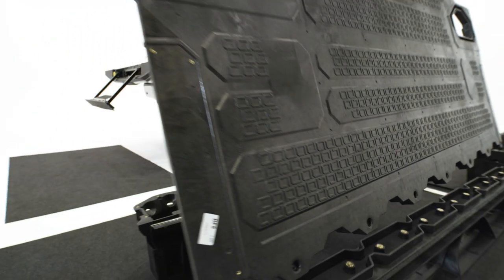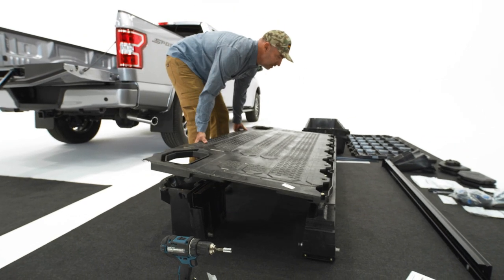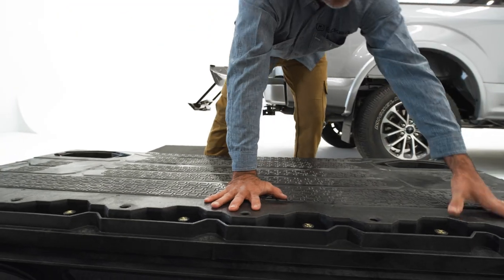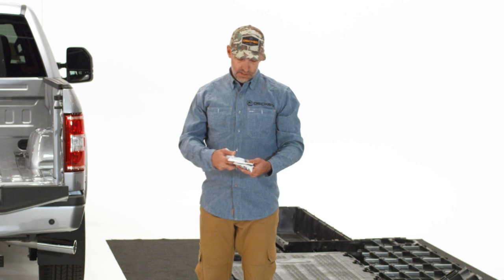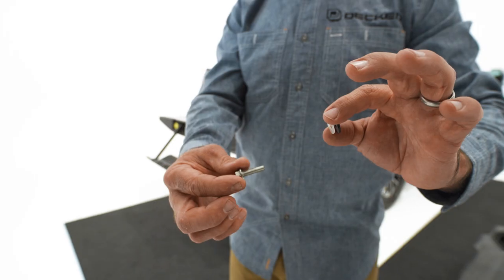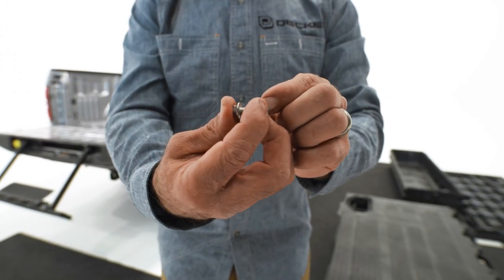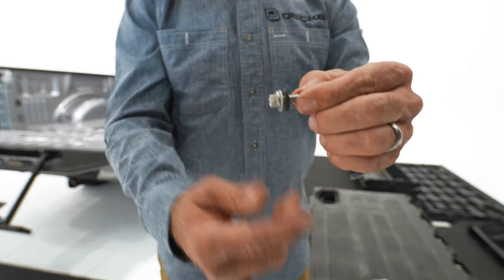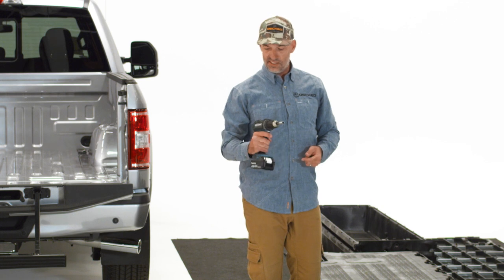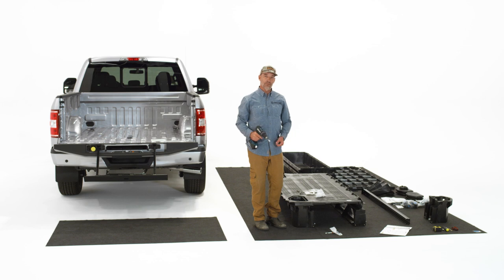It's really important that you put the driver's side panel on the driver's side of the truck, then just set it down on the center vert. We're going to need three different bags of hardware from your kit: the cab side ammo can bag, the second bag with washers, and the third bag bolt FS1. We're going to prep these bolts — the bolt head will first have the nylon washer next to it, then the rubber washer below it. Set your clutch pretty low, like in the first third — around seven — and turn your drill speed down to the slow speed. That'll keep you from putting too much torque on the brass inserts.